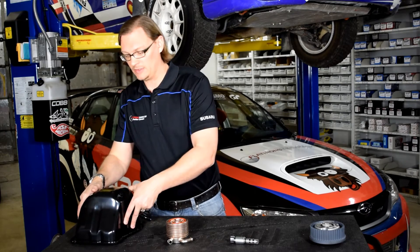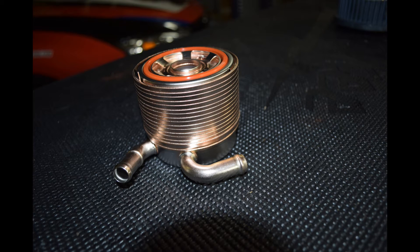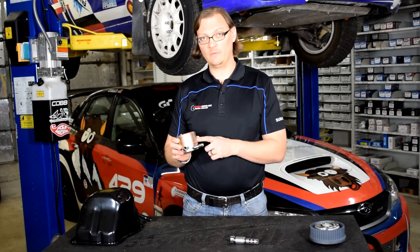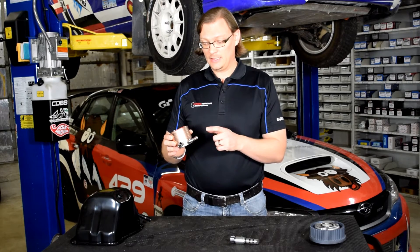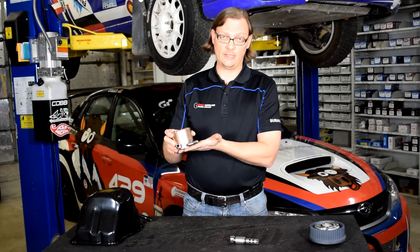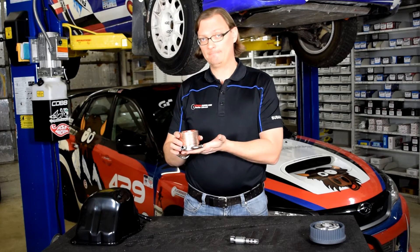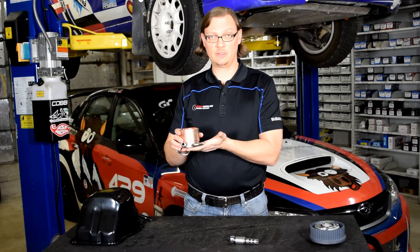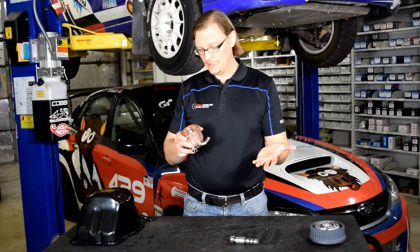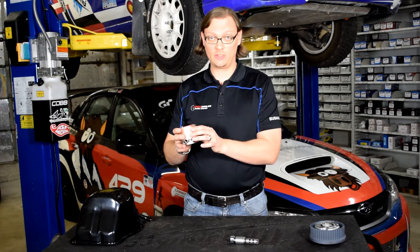One of the most common things that's overlooked is this — this is an oil cooler. If you have an STI, you have one of these. The Legacy GT turbos have this; the WRX only had them from 2002 to 2007, and starting in 2008, Subaru actually removed this on the WRXs. Both oil and coolant flow through it. This side goes to the engine block, and your oil filter goes right here. The oil that sits in the oil cooler — there are so many chambers in here that your ability to flush it out and be 100% certain no metal contamination will transfer over is basically zero. So anytime you have a bearing failure, this is something we very strongly recommend replacing.